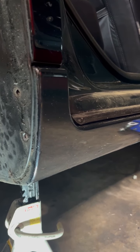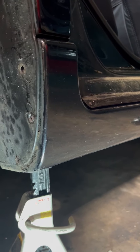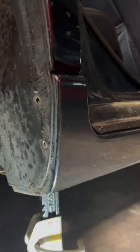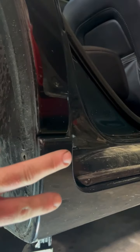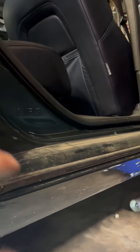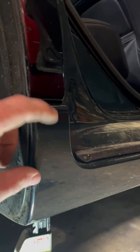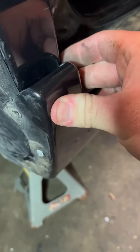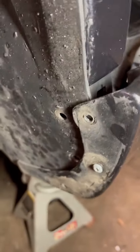Here's the point I was talking about earlier. This is an '05 S60R and I'm putting on a sport kit from a 2007 S60R. I'm not sure if they're all like this — this is the first sport kit I've personally put on. I removed the three rivets and we're at the rear passenger door area. There's a body clip here on the stock skirt that is completely missing from the sport kit — doesn't even look like it broke off, just gone. Same with the front fender corner: the stock clips in nicely right in the corner, but the sport kit doesn't have that. With the doors open, you can see multiple factory clip spots, but on the sport kit there's literally just the rivet attachment, and one clip goes right in here.